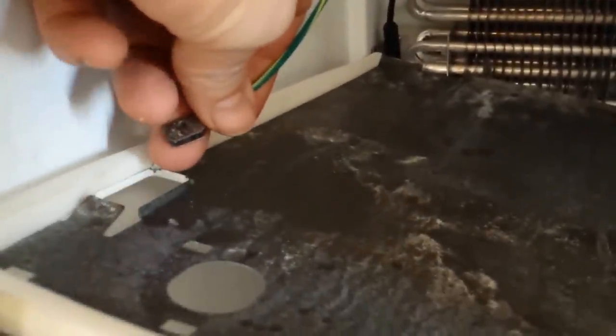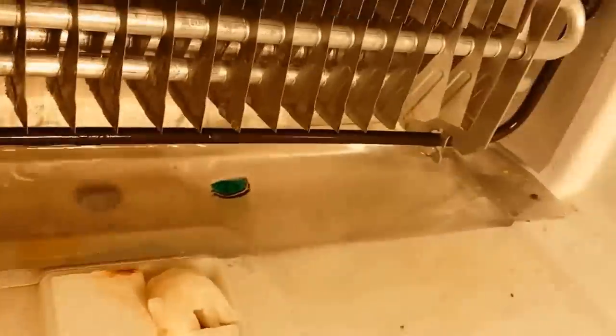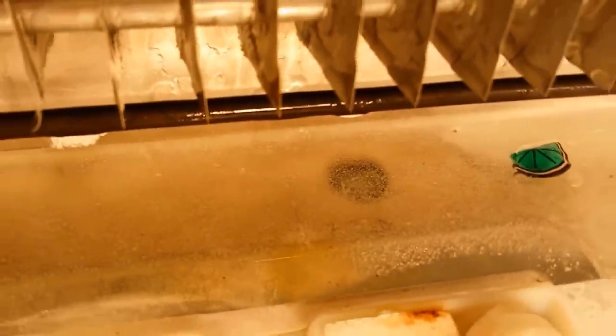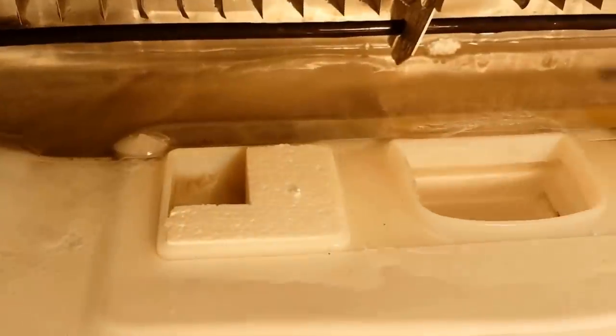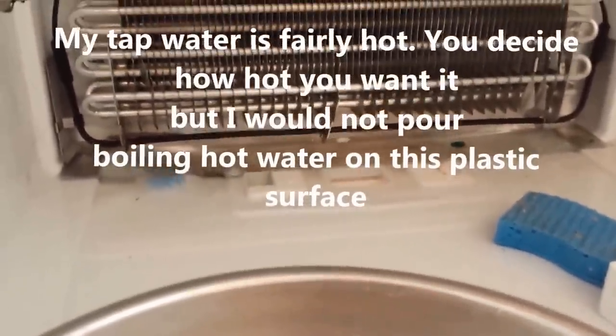There are actually two more screws — you can see them, one there, one there. There's a wire harness along the back, so I'm going to have to pop those two apart in order to get it out. On the back there's also a ground wire clipped right there that you have to gently pull apart. Now this thing can wiggle free and you can pull this back plate out. This whole ice dam that has formed along the back is what's preventing the drainage. You can see that little black spot back there — that's the drain pipe that's supposed to run out and empty the water if it builds up inside here. And that's the problem. I'm just going to keep pouring hot water on there and then sponging it up into this bowl until I get it all cleaned out.